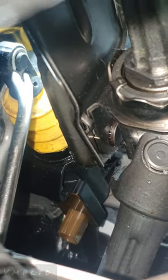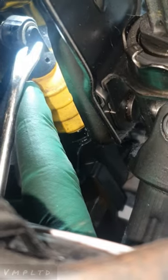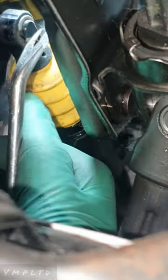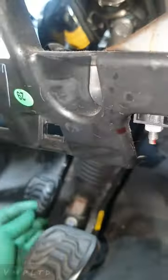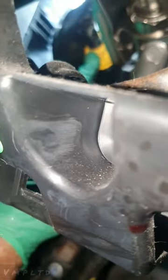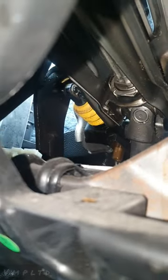You can remove it - I could use a tool like this. You just have to push it - it's horseshoe-shaped, so it'll have an opening and you're going to push it the opposite way to the opening and it'll come off. I didn't show this on my previous video because it wasn't there and it was the first time I'd come across it. The issue with that one was this part of the master cylinder had sheared off. If I'd met one like this I would have said you have to remove this from the clutch pedal.